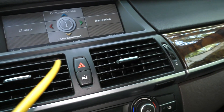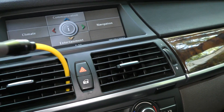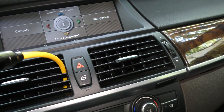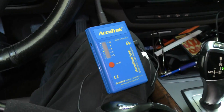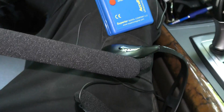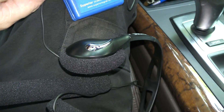Well, with the AccuTrack, you just push the button and turn it on. Then with the car turned off — and the fan off — you can just stick it inside here and listen for any leaks. You'll hear the ultrasonic sound that a leak makes. As you can see here, I've got the microphone, and the microphone is going into the headphones, and you can actually hear the leak.